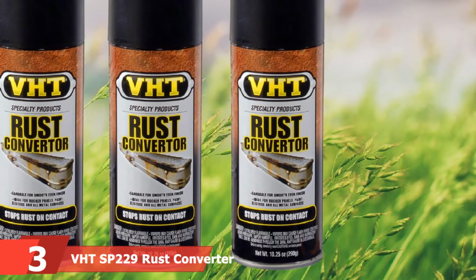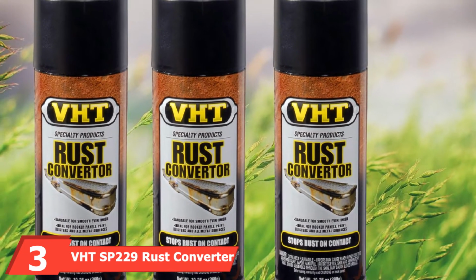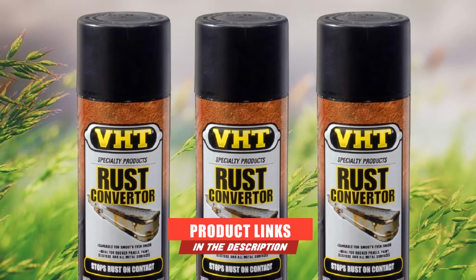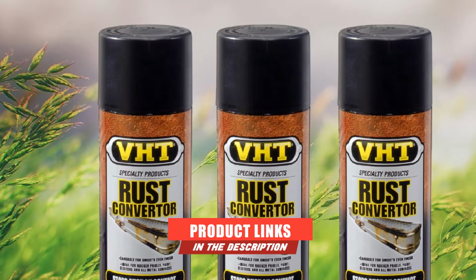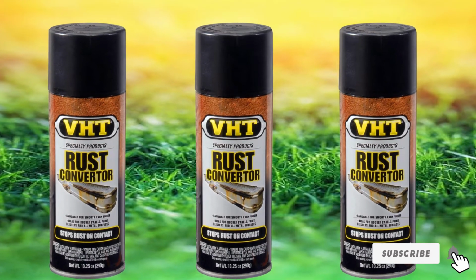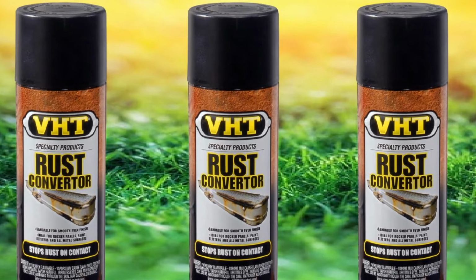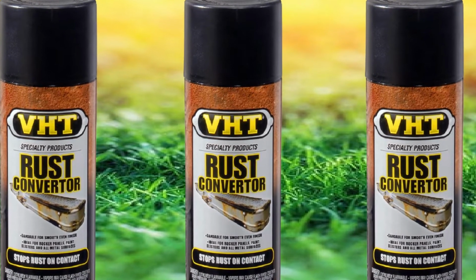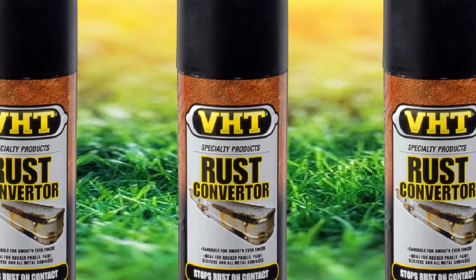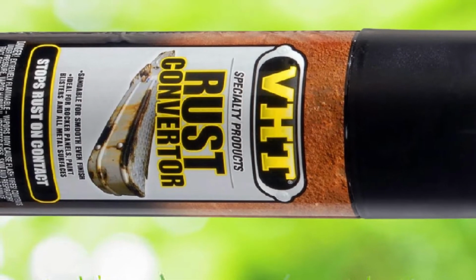The number 3 position is held by VHT SP229 Rust Converter. This honorable mention for corrosion removal is made by VHT. VHT's Rust Converter is very user-friendly, as the spray can is used to apply the product, only needing to cover the corroded areas. The solution sprays on clear, then turns black once dried. The spray is formulated to protect areas from further corrosion. Once dried, this rust converter can be sanded and painted over.